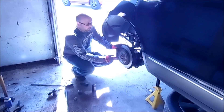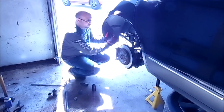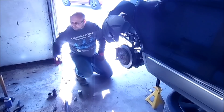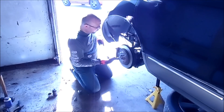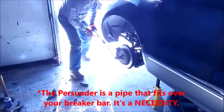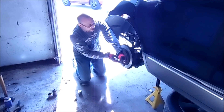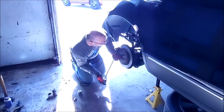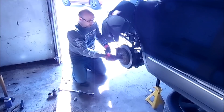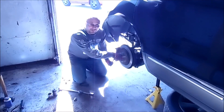On this side, since I'm going to do the hub as well, I need to take off the axle nut. The way I normally do this is I'll take a big screwdriver and put it in one of the cooling ports on the rotor. Then I'll grab the correct size — it should be a 32mm, which it is. Then comes the fun: I have the breaker bar, then I grab the persuader. What you want is as much leverage as you can get — and don't pull, push. This one was actually a lot easier than they normally are — putting the screwdriver in the rotor is probably about the easiest way.